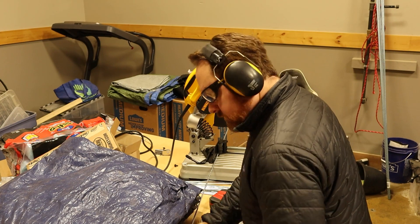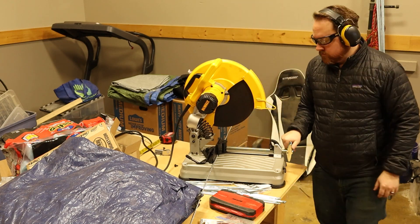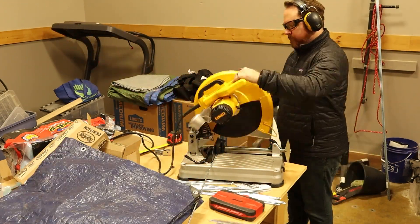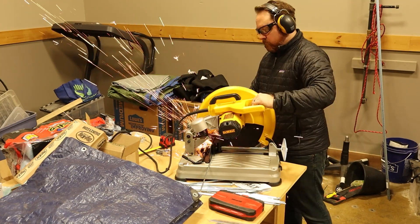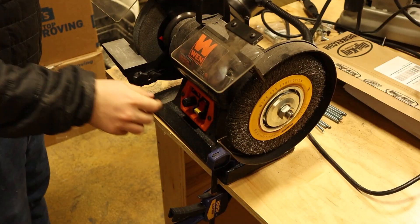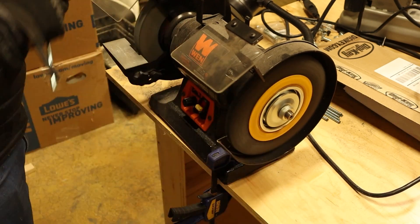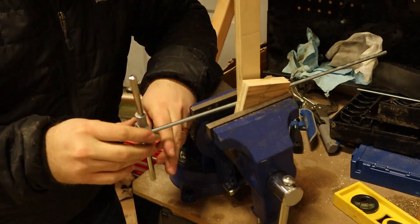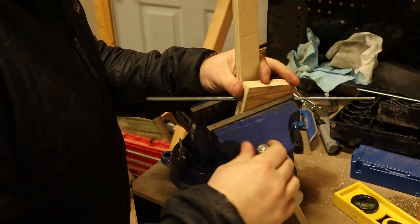With the design complete, I was able to create a cut list. I'm using a 14-inch chop saw with an abrasive cutting disc for most of the work. I also use an angle grinder with cut-off discs and a 120-grit flap disc. First up is to cut all of the threaded rod. Since there are 10 battery modules and each one has four, there is a lot of repeat cuts. Each cut edge of the threaded rod then has to be quickly cleaned up on the grinder and wire wheel — this is repeated 80 times. Then each edge gets a run-through using a die set to further clean up the threads, and I test fit each one with a nut — again repeated 80 times.